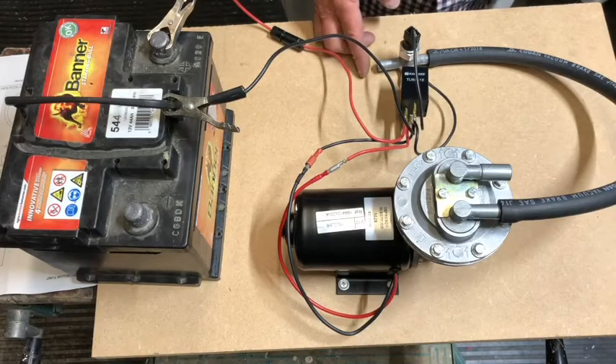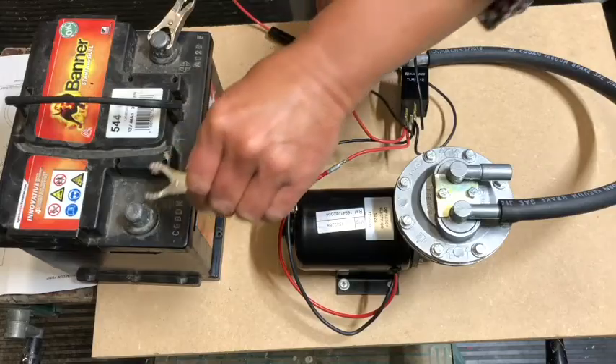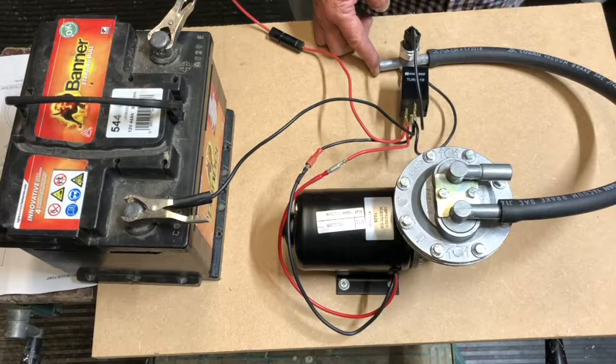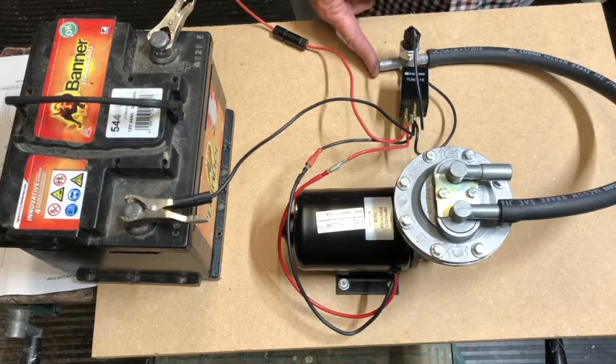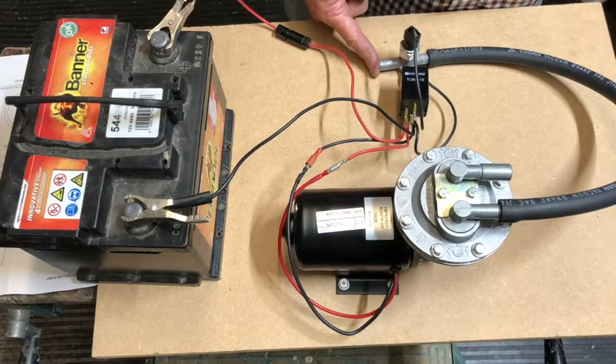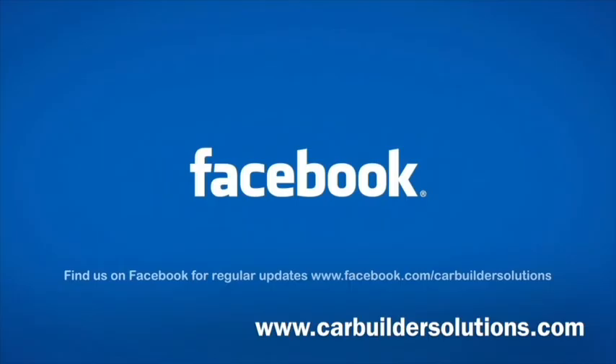Because we haven't got a servo here, I'm just going to put my finger over the end of the vacuum switch to simulate a full vacuum. Okay, let's connect up and see what happens. There you go — it switches off. If I put my foot on the brake to release the vacuum from the servo, it kicks back in. Thank you.